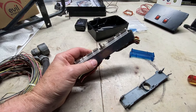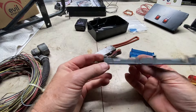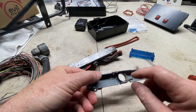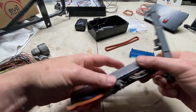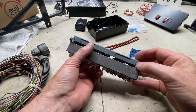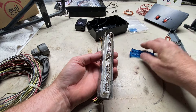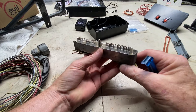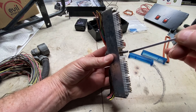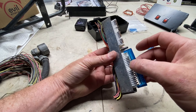If you've never taken one of these pin modules apart on your PCM, probably the trickiest part is just getting the cover off — there are six pins, two on each end and one on each side. It's just a matter of pushing them in with an ice pick or a small screwdriver, getting a little leverage on each one, and finally it just comes out. The rubber seal is on the inside and comes out easily. For the two blue clips, there's a little plastic tab — press one in, pull the blue covering up a little, press the other side, and it'll slip right off.